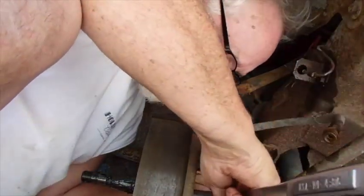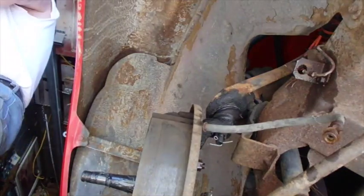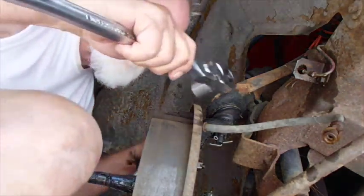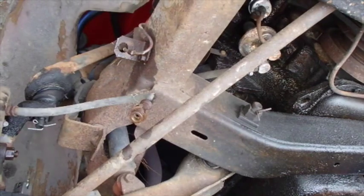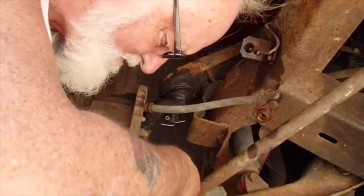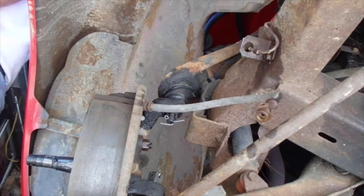What I'm going to do is go on the outside of the car there. I might need a little socket right here, and I might wind up going with a pull bar or a little ratchet to break them loose. Looks like the threads are messed up on this one — right there. I believe somebody tried to put something on there that didn't fit. Let me check and see if I've got a 6-point 11/16ths anywhere before I go any further, and I could also try getting my air wrench back in here and let it wobble around a little bit.